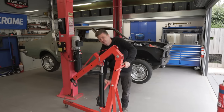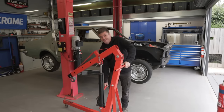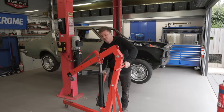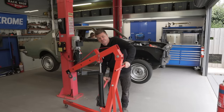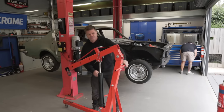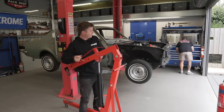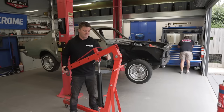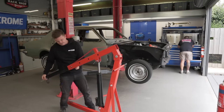While Nathan is painting everything and we're waiting for it to dry, we're going to do the engine mounts. The reason we're doing these engine mounts is they're pretty stuffed. When we put the car in and the weight went onto them, they just absolutely squished to about half the size of what they should be. So we should probably fix that — we've got some new ones. We're going to sling the engine, lift her up, probably one side at a time.